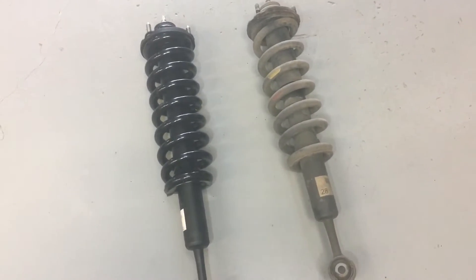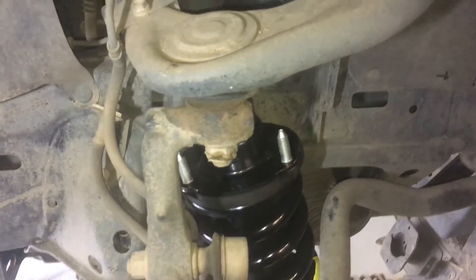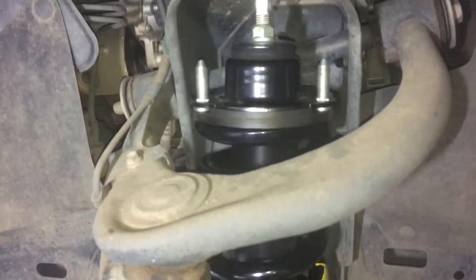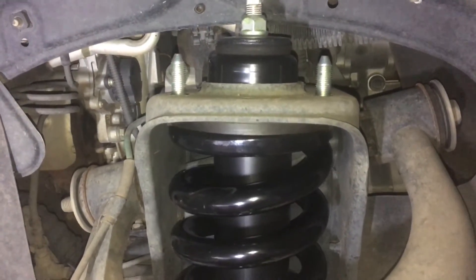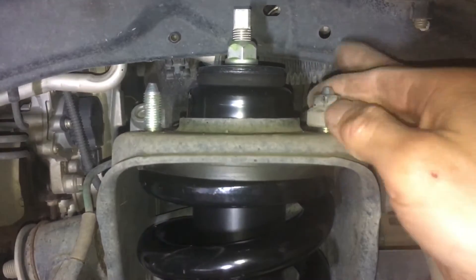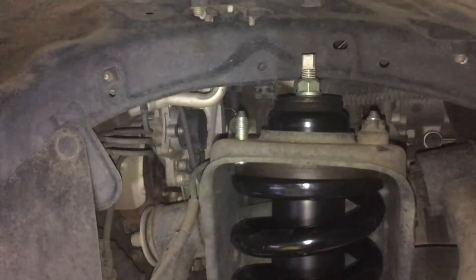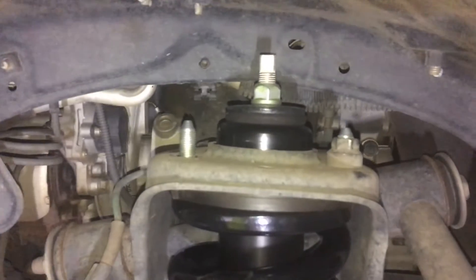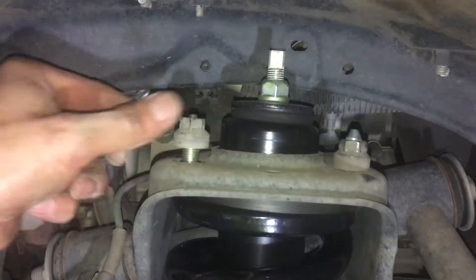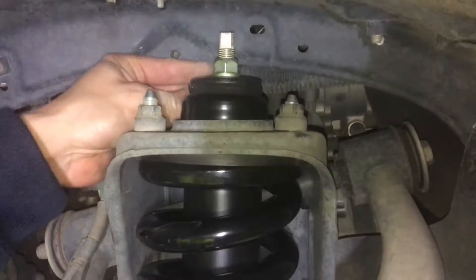Let's get that nice clean one up and whack it in the vehicle. Bringing it up nice and gently — careful, we don't want to scratch that beautiful new thing. Look at that — beautiful new top hats, genuine springs, shocks. Over 300,000 Ks — probably a bit too long, but when you know what you're happy with, that's what you do. Make sure you've got a nut handy, do it up all the way, and then of course you can rest your arms and go and get the other two nuts and get those started when you're ready.